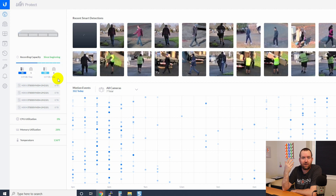With about 24TB of total space available, that gives me close to 100 days worth of recording capacity the way I have this configured. Most people who have the UNVR aren't only going to have three cameras running, so expect that number to be a lot lower. If you had 12 or 15 cameras on this thing, you might have 20 or 30 days worth of recording capability.